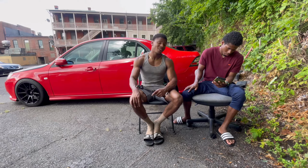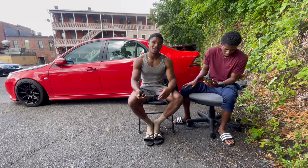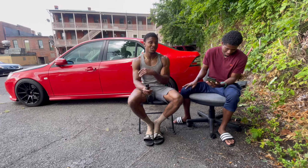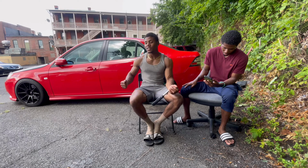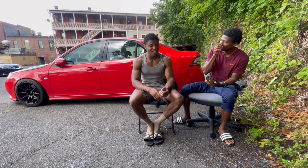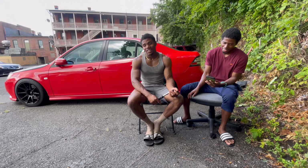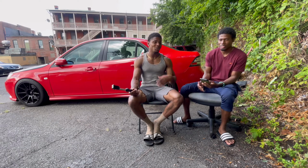And honestly, for the manual transmission, I would say when you start getting to 600, you might want to consider the transmission. The third gear tends to break after that, but not saying yours is gonna break. It depends. If you're no-lift shifting, you're gonna break the trans. I don't no-lift shift mine, so it's been holding up perfect. So I don't know the limits. Like I said, we don't know the limits. We're still new to testing it.